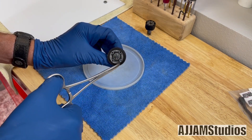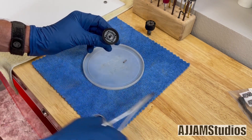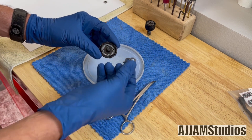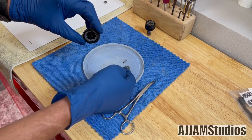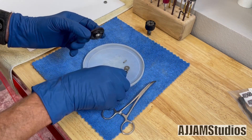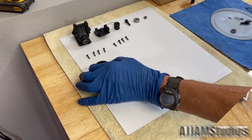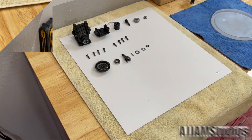Make sure and leave the gasket in place if it's not damaged. Go ahead and pull the drive pin out and set that aside. Here's a little trick: if you just retract the drive cup a little bit and then push up, it'll pop out both shims and the O-ring. That allows the drive cup to come straight off, which also gives you access to the bearing on the outside. So here are the parts involved on this easy side: an O-ring and two shims.